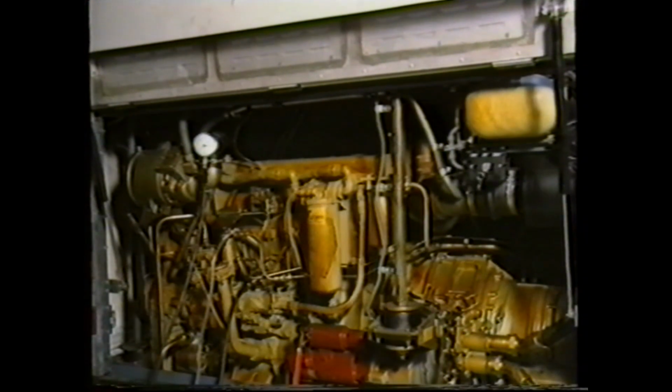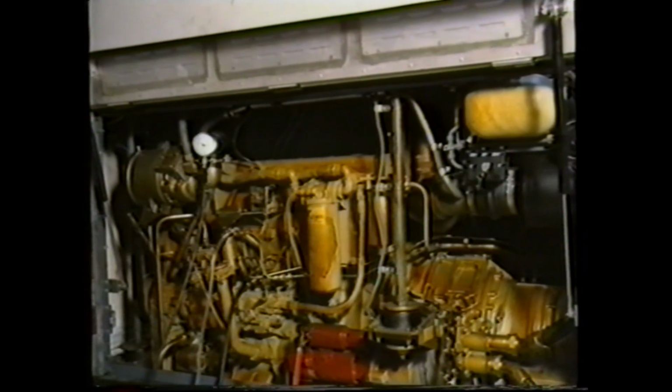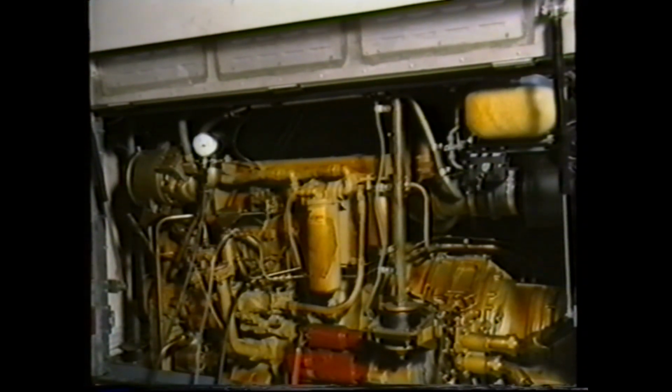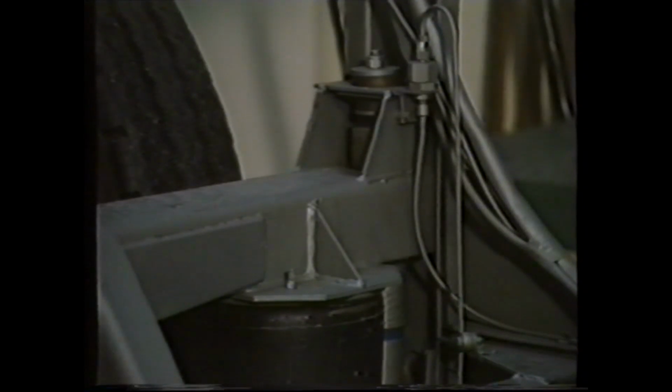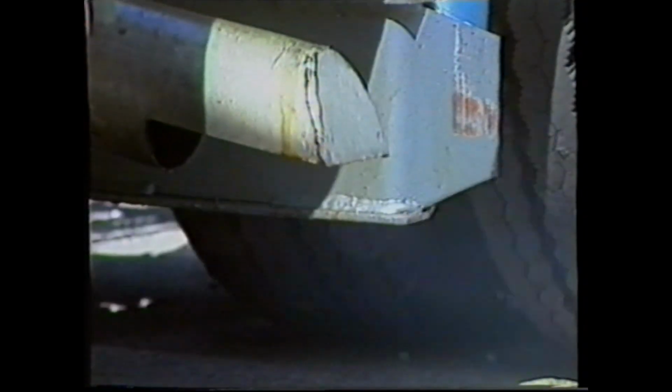If this is substantially higher than specified in the support notes, the fuel pump needs to be removed for inspection. If in order, check the return pipe for restriction and also the tank vents. However, if there is a fault in this area, the black smoke would be accompanied by slow die-down and run-on, as discussed in earlier fault conditions.